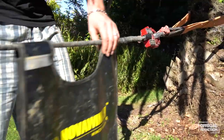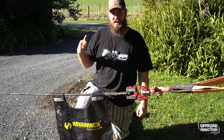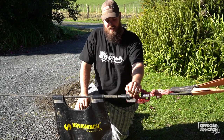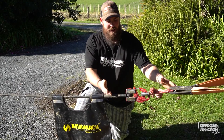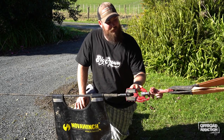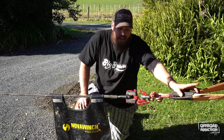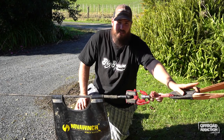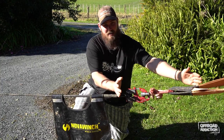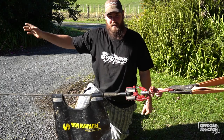And what the cable dampener is designed to do is if it breaks, it wants to take the cable down to the ground. And that stops the recoil from coming back through your windscreen and causing damage, or just hitting one of the panels on your vehicle or a bystander, which we don't ever want to see. Generally, the equipment at this end won't fail unless you've got a cheap and nasty winch hook on there that is made out of inferior material, then it could possibly fail. If you're using a cheap tree trunk protector, generally they're pretty good, but you have to keep up the maintenance on it. If the fibers get worn, then it could break. But generally speaking, if your gear is in good condition, this end is normally quite safe. What we're trying to stop is the rest of it coming back into the vehicle or into an innocent bystander.